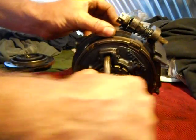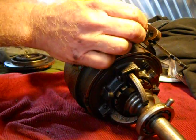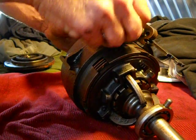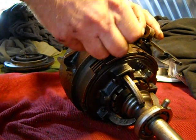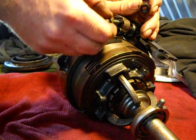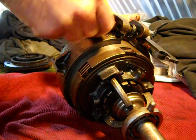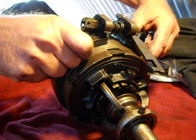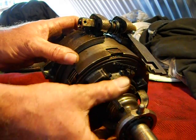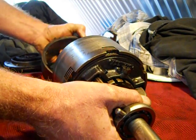To get the brake band off, you would loosen this nut — or you remove this. You take that spring clip off. This nut just holds this clip on, which prevents this from spinning. Now to get it off, you loosen it — lefty loosey. That will spread this out, and this will be attached to the shifting lever, so you can remove this part.